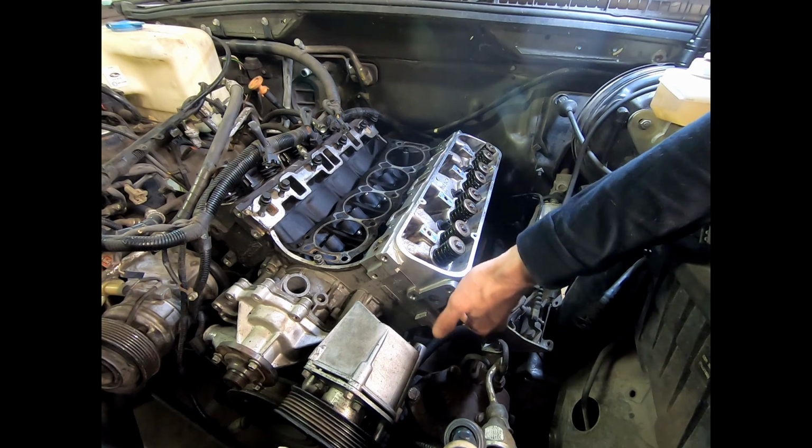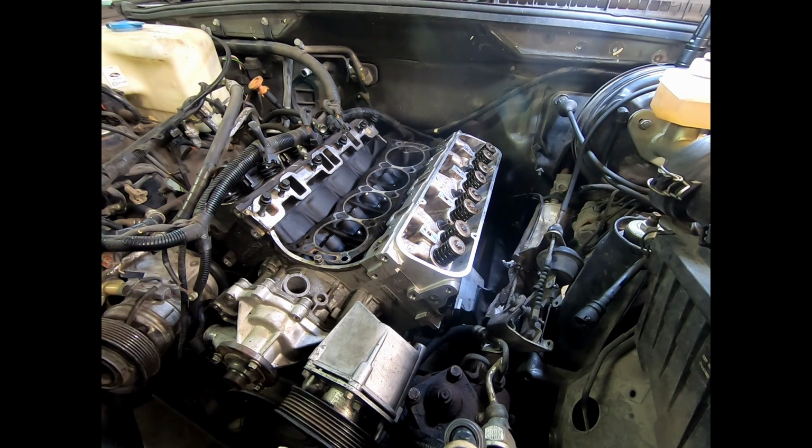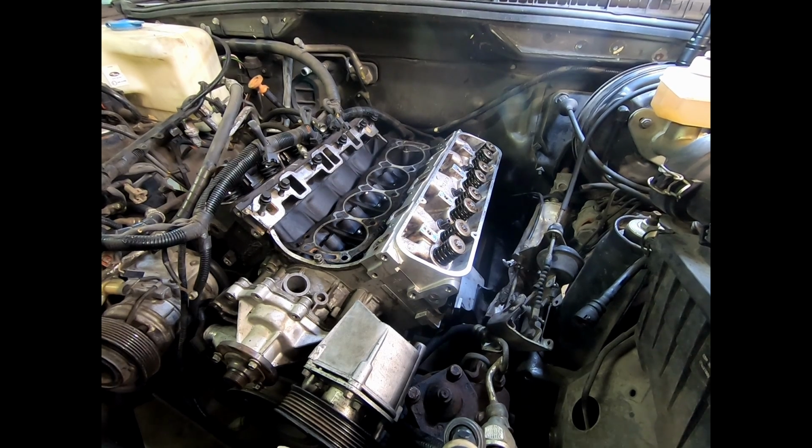If you do torque to yield bolts, they tell you to clean it up really well too, but ultimately this is why I believe, and a lot of engineers seem to believe, that this is the superior method. Anytime you're doing performance modifications to a vehicle, they almost always have you doing head studs like this. Next, we'll put the nuts on.